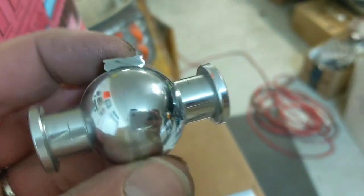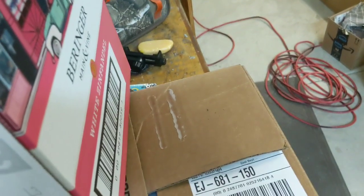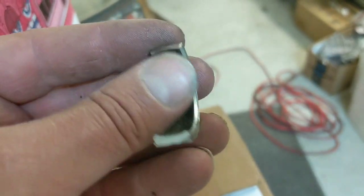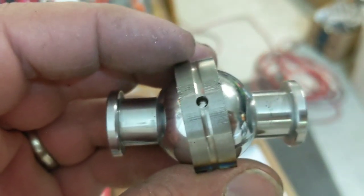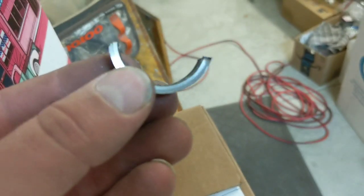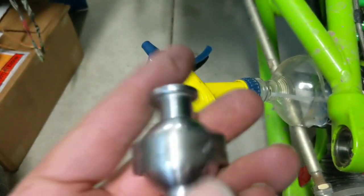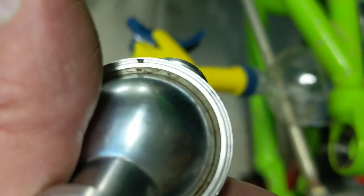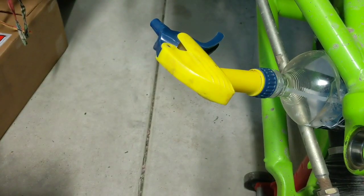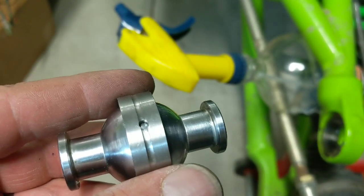Here's the one from the passenger side that was taken off. Out of curiosity I took a cutting wheel and cut half of the joint — the ring, the socket — off, and you can see it has a nylon-injected runner in there that's most likely molded in through that hole. That's what's wearing and disappearing — you can see it doesn't protrude anymore when you look at the new one. That nylon is hiding in there and that's what wears. That hole is not for lubing — I'm pretty positive that's how that plastic gets injected in there.